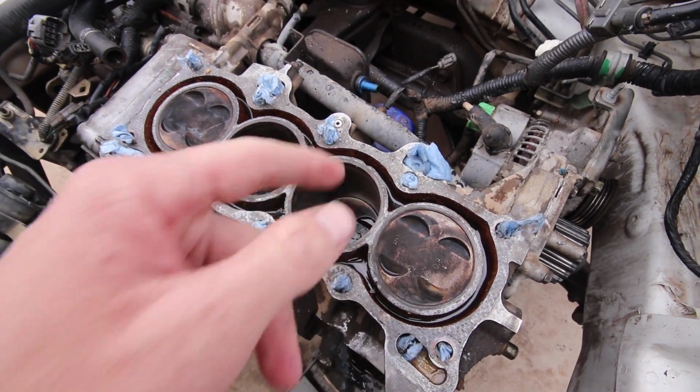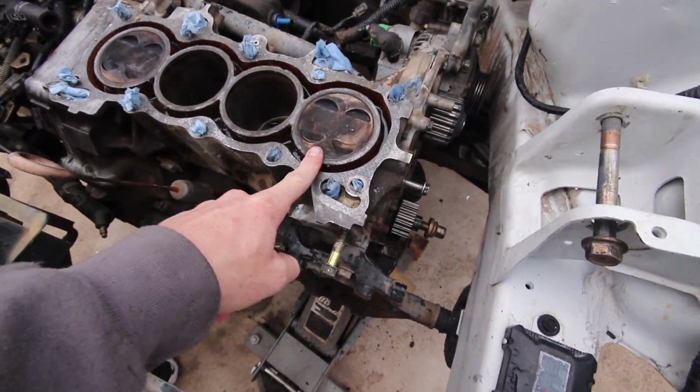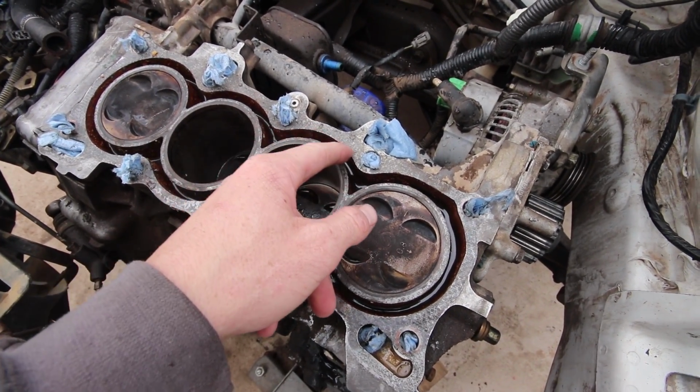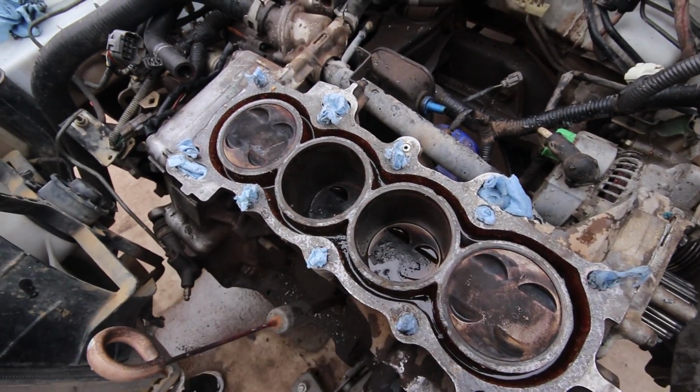But it's all rusted. Obviously the owner before, Giovanni here, has definitely, in this car's many years of usage, had straight water in here, because if you're using proper coolant or the right mixture, this amount of rust isn't normal, I would assume.